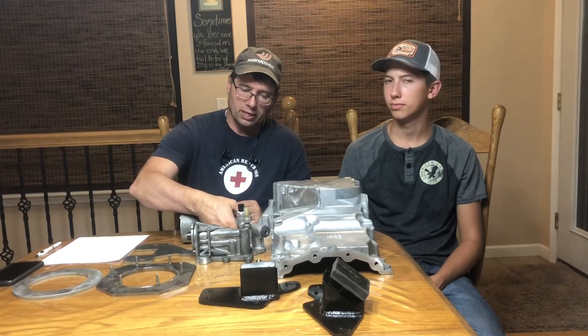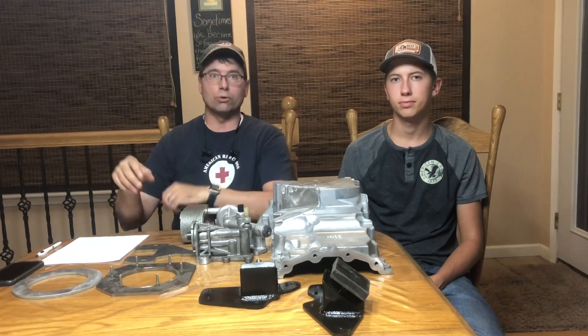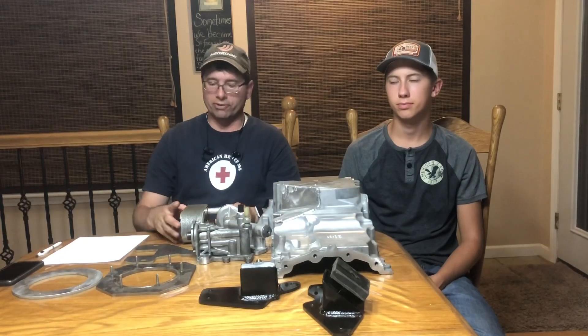We also have a fuel tank that will be modeled closely after some of the aftermarket ones already available that have this fuel pump unit pre-installed. We're working with a supplier on a mandrel-bent, CNC, 304 stainless steel exhaust — two-into-one, so two-and-a-half inch tubes coming off the turbos going into a single muffler, with a three-inch tailpipe off the back. Since we're not running a catalyst, you want just a pinch of back pressure to help with torque and overall engine performance, and three-inch tailpipe is just about perfect for that application.